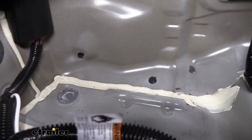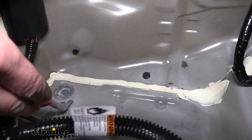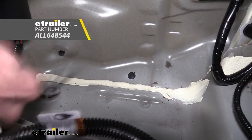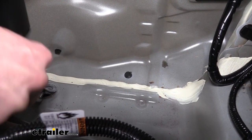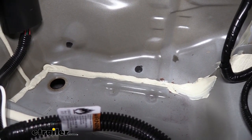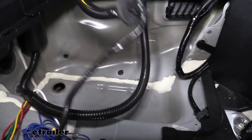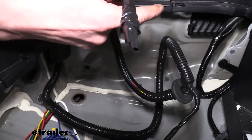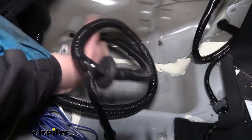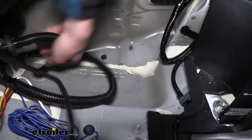Next, we need to route our wires to the correct location. We're going to start by accessing the grommet. Our module is located on the back wall, so straight below it we'll have a grommet. You can use a flat-bladed screwdriver or a trim panel tool — you can push the grommet straight through or pull it up. There is a panel on the bottom side of the car; you may need to remove it to access the wiring. If you've already trimmed out a hole when installing your hitch, you may be able to reach through. We're going to take the wire loom — there are just bare wires taped up here — and poke it down through the grommet until our new grommet, which is part of the harness, is seated in there.